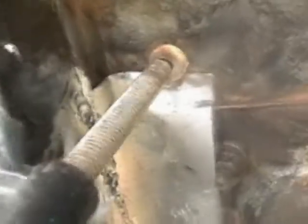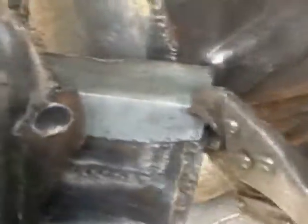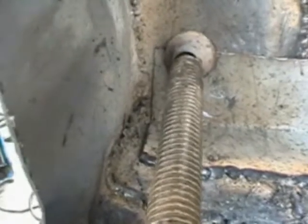What we've done here is we've got the old G-clamp on there. We're just going to weld this little bit here, and then we're going to carry on knocking the metal closer to the parent metal. You can see that — it's getting welded now, it's becoming more and more secure all the time. So we've just got to work the way round the side here now, past that bolt. Here is the answer to that hole that was lurking behind there — we're going to weld over it with this piece. See all the time we're working the metal closer and closer in.